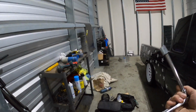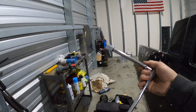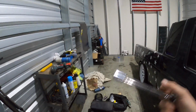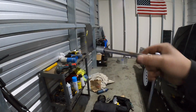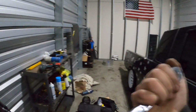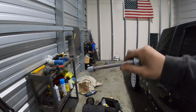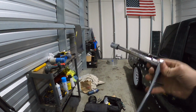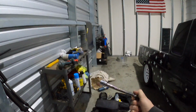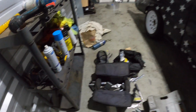I didn't realize that this would work, and I used a box-end wrench without a ratcheting wrench, and the bolt's about that long. So you can imagine how long I was under there twisting. Frame clearance and stuff like that is the reason why you have to use this exact ratchet, because you'll hit the frame with anything longer than this. So this will save you a ton of time. Use this exact setup to get the upper bolt out and back in, obviously.